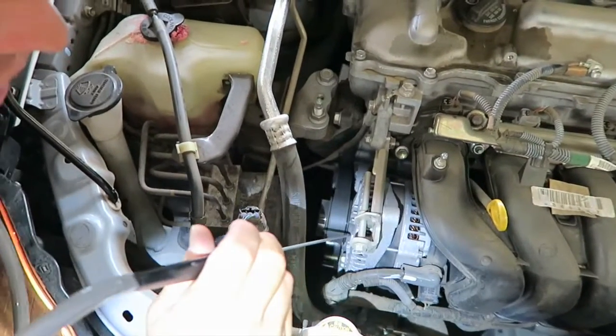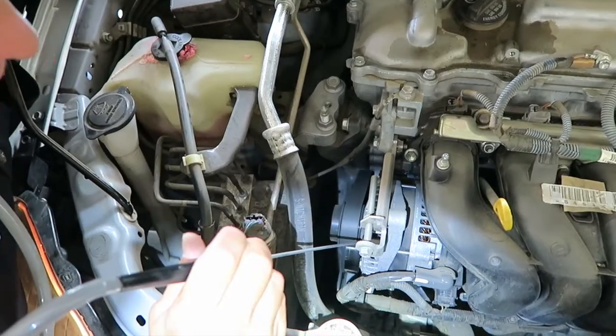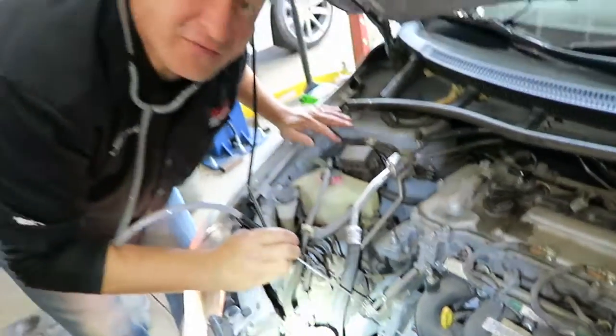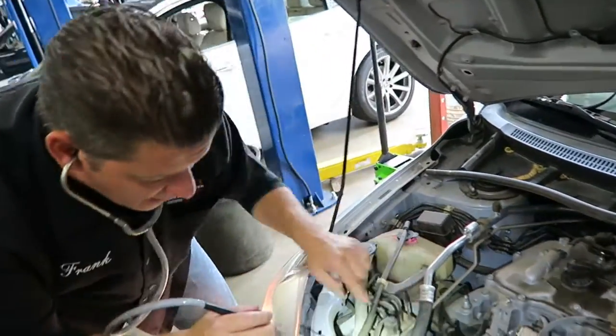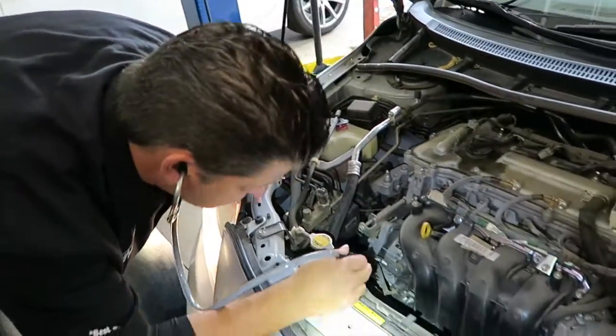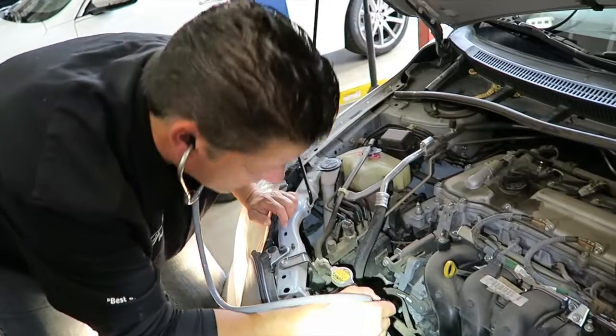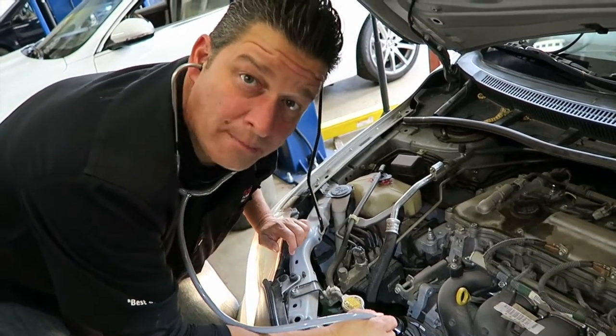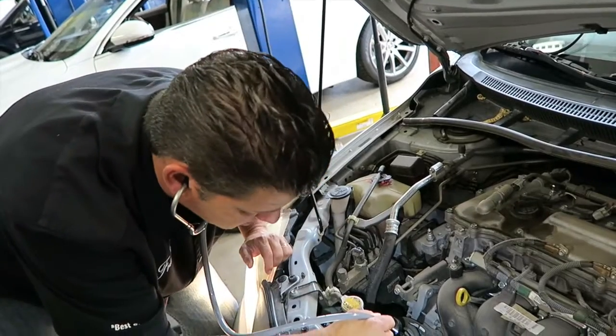Be very cautious — go right in there and listen. There's a certain rhythm to the type of noise you're going to hear. Then go right down into the water pump. I always like to start on the backside, and you can definitely hear a noticeable rumbling.